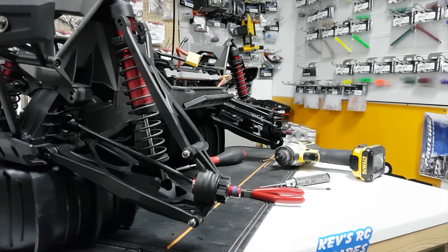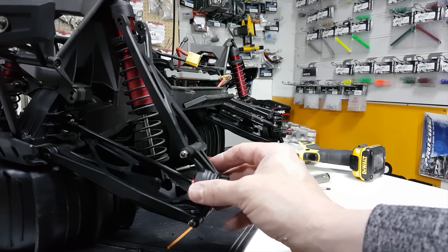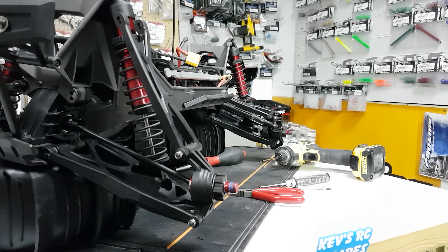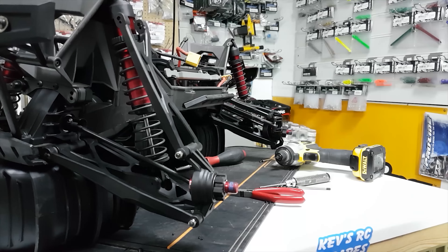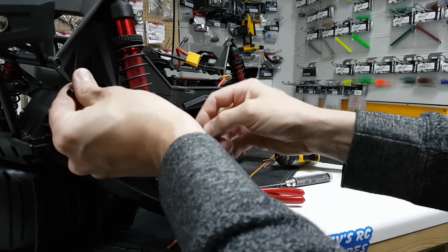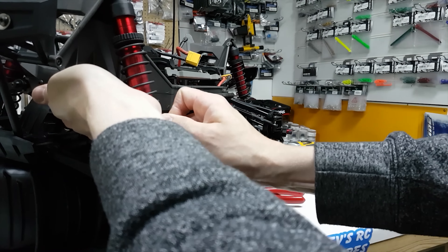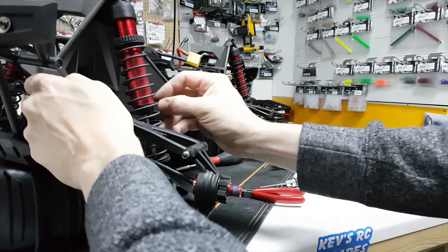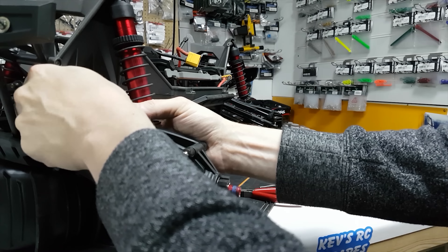It's got so much flex in there — the standard one will never have that. Even the bottom arm — look how much flex is in there. That's why it's not breaking, guys. That's why when people fit alloy arms — and guys always ask me do you fit alloy stuff — definitely not. If you fit alloy arms there's no flex, it's going to be solid, and all you're going to do is end up ripping out the bulkhead. Stay away from alloy as much as you can, especially on an X-Maxx. Something this big, you want it to give; you want stuff to flex and then flex back. The only exception — I haven't tried it yet — I would possibly put on alloy hubs front and rear, and maybe alloy bulkheads. But arms? 100% never ever fit alloy arms.